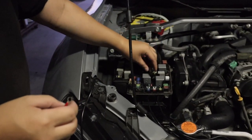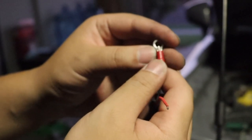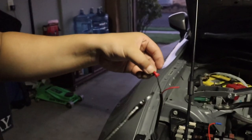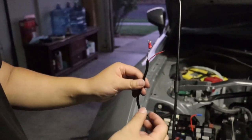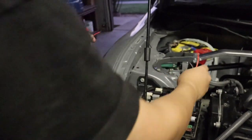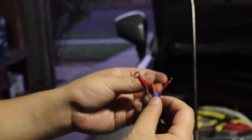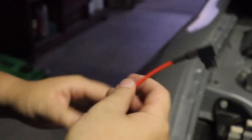I'm going to connect it to the fuse box. Let's do the negative first: black is always your negative. You stick it in like this until it kind of pops into place, then you clamp it right here. It's not perfectly snug but it's not going anywhere. After that, put some electrical tape on it. For the positive, you stick it into the positive connector and clamp it in the same way — and it should be secure.